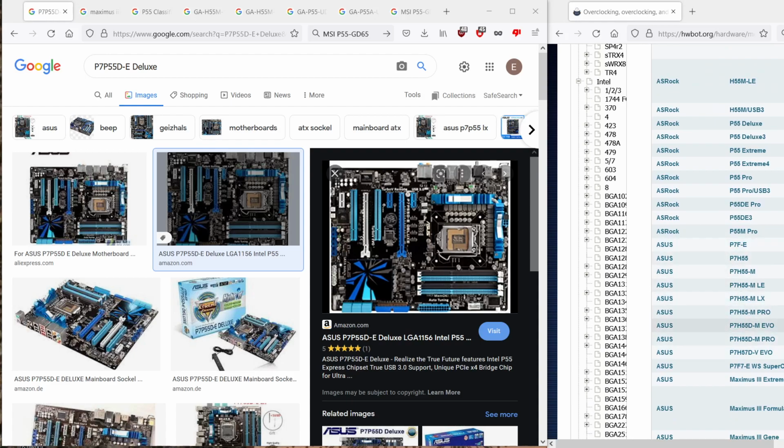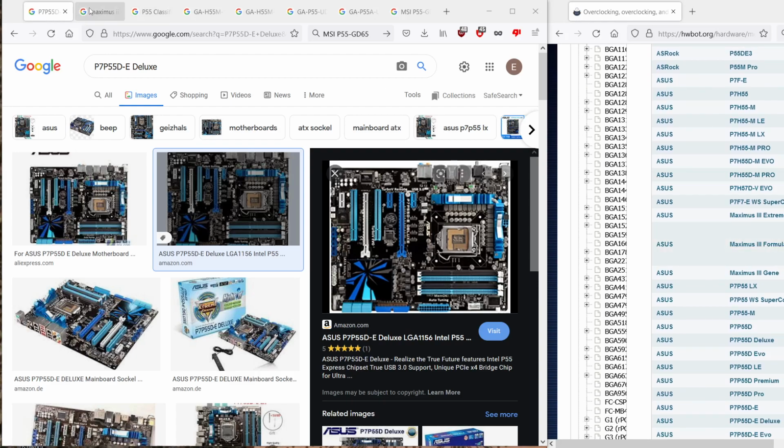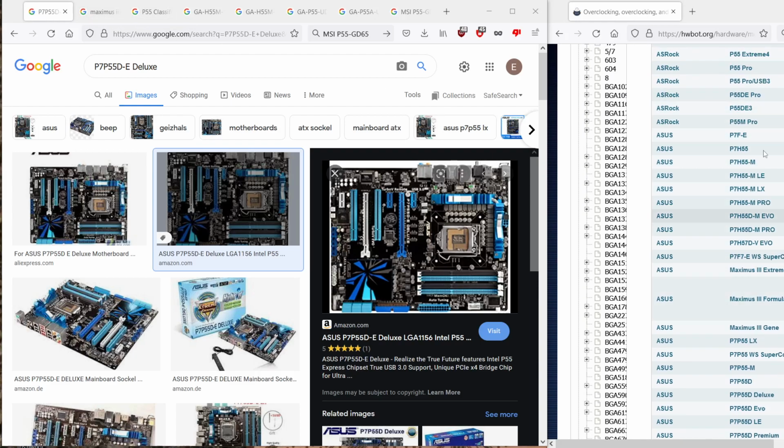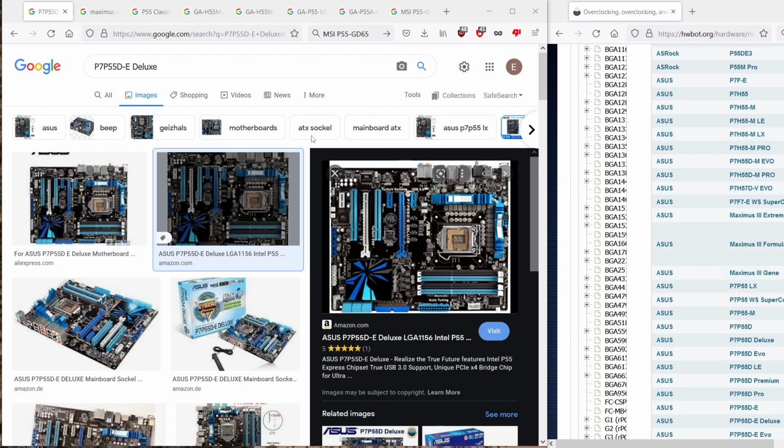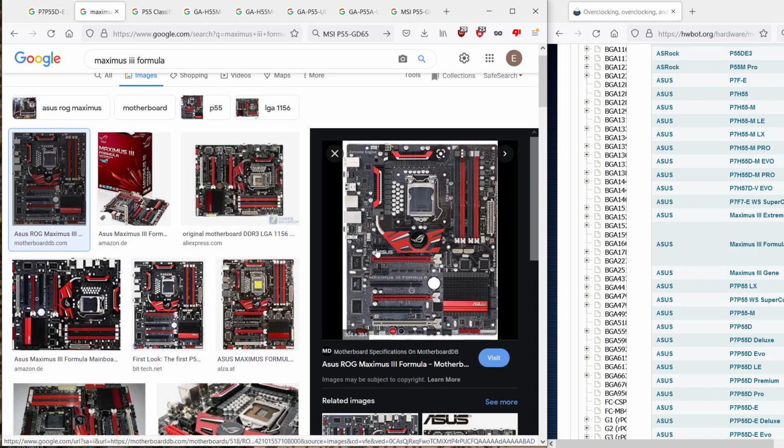Now, there's a whole lot of this is H55. Don't mind these. Let's go H55. There is only one manufacturer I would say that makes good boards that you should get, and we're going to get to that later. Anyways, no ASUS H55 for overclocking, not even for dual cores. However, here is the first one that is really far up the list, the Maximus 3s. Now, they somewhat lack on FSB, and by lack I mean they top out at around 255, maybe 260-ish in my experience.